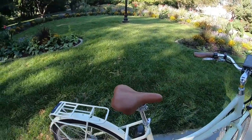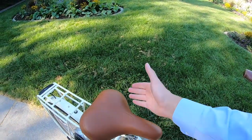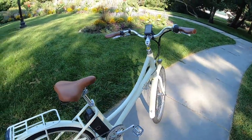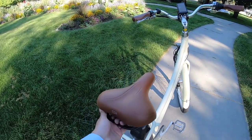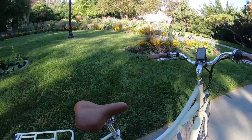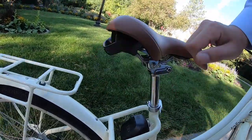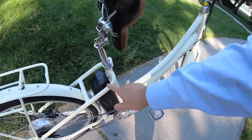Coming up to the middle of the bike, let's talk about the seat. It's about a seven-and-a-half-inch wide footprint — a middle ground between an athletic narrow-nose seat and a wider cruiser-style platform. I like it; it's a good choice for city riding because sometimes you want to sit back and relax on the way home from work, and other times you go into high gear when you're running late. It does have a handle on the back to maneuver the bike. The seat post has a quick release mounted to the side intentionally so the battery has clearance to come out — and there's a trap door: if you pull up on the little tab, the seat rocks out of position to give you battery access.